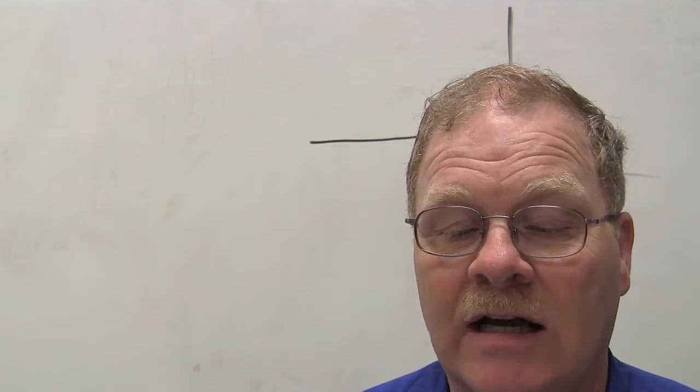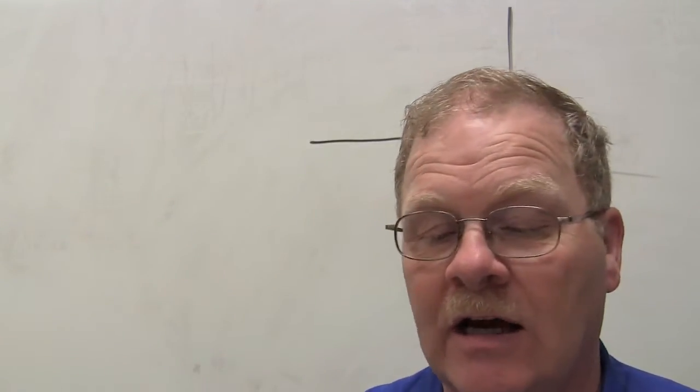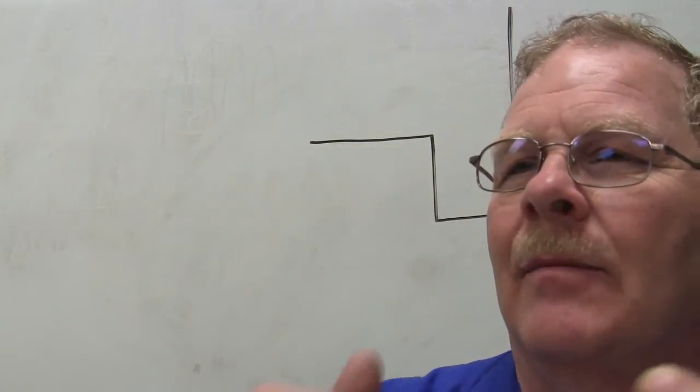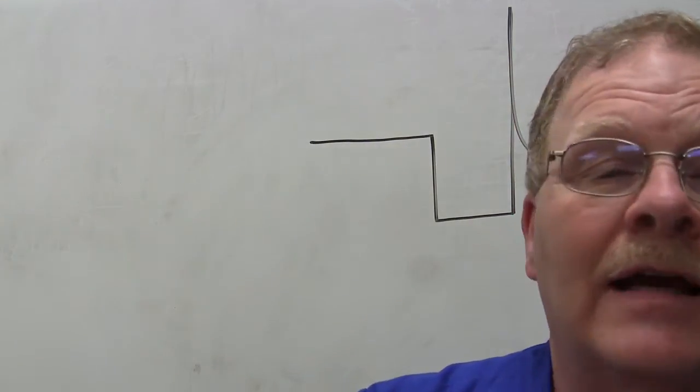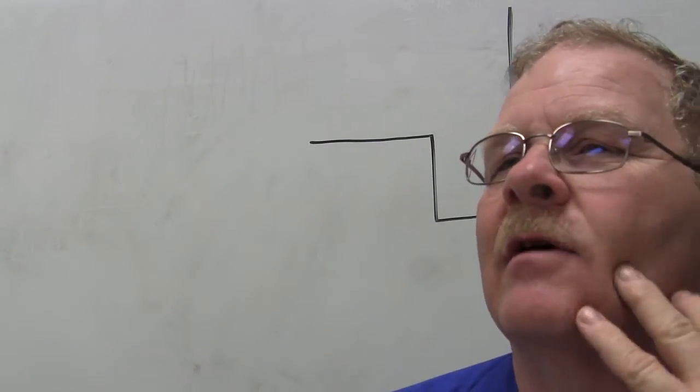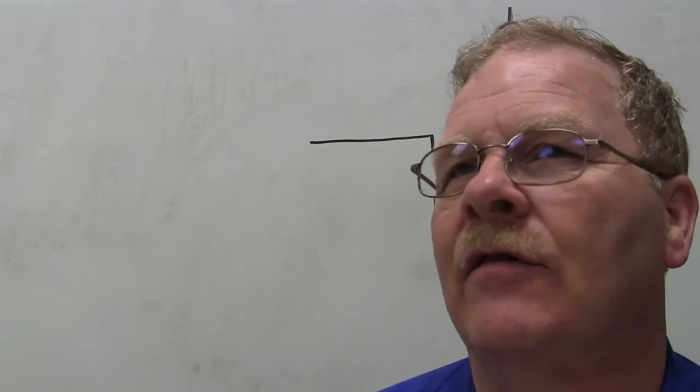Basically, believe it or not, you can use an analog voltmeter because it just sweeps and you just count the sweeps. Now, what I did was I built me a little box with a light in it. I had a button, a box, and I built that thing and I'd plug it in and I'd mash that button. I'd put it in the self-test and I'd watch that light flash and I'd just read them codes up a storm.